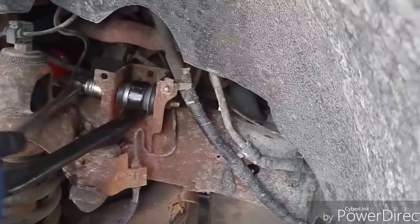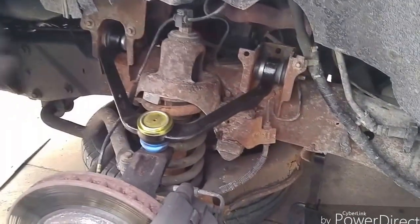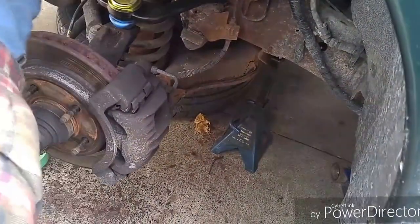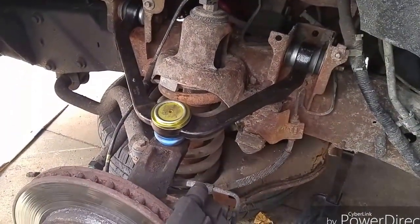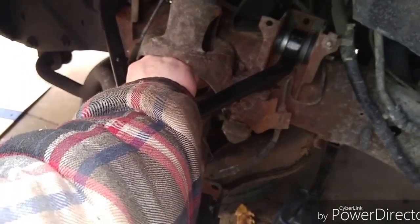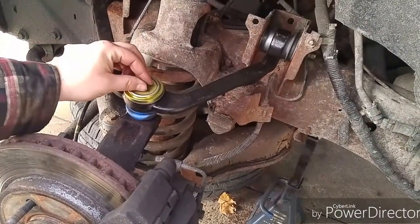It's as tight as you can. Now there's an extra grease nipple and cotter pin — same with the tie rod. Aftermarket ball joints and bushings come with their own grease nipple and cotter key. Let's get the grease nipple on so we don't forget — don't lose it. Don't strip the threads; if it's not turning in by itself, take it out and try again. It's crucial since we just put the thing in already.